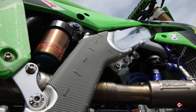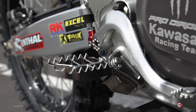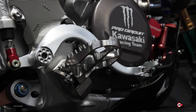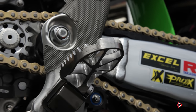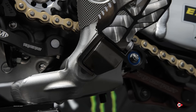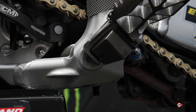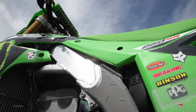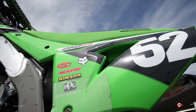We're running grip tape made by Vibram — a team sponsor. They provide it pre-cut, ready to go, and it actually lasts pretty long. Our foot pegs are designed in-house, same with our foot peg mounts — just stock springs and foot peg pins. We run our pins backwards so the cotter pin is out of harm's way from dirt and rocks. To keep mud from packing into the springs and pivot of the foot peg, we run titanium peg armor, and we also design and produce our own air boots — that's all stuff you can buy. We're probably a good six generations into the air boot, and we build the engine to the spec we like, then fine tune it with the air boot.